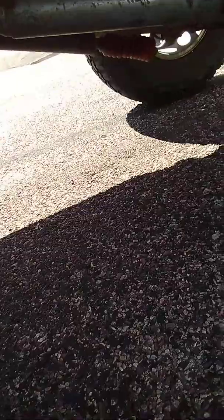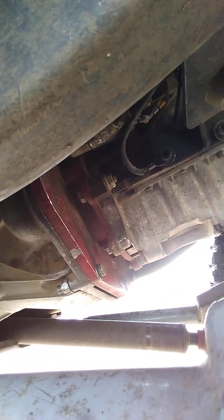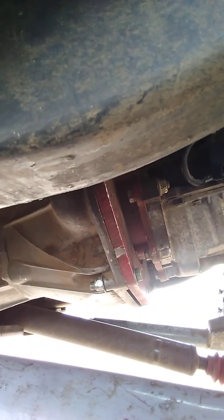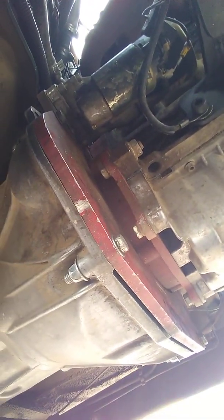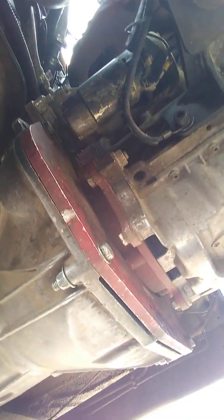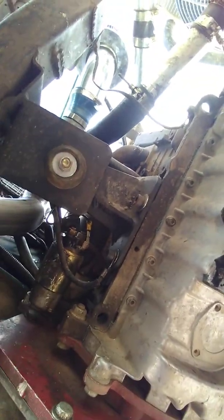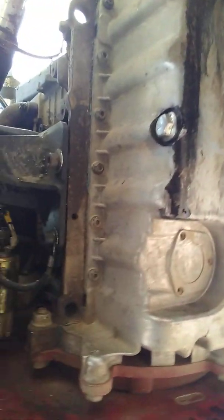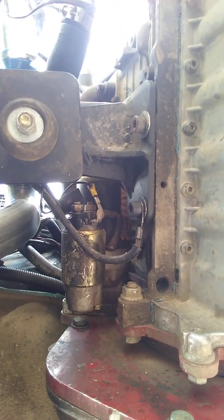The adapter kit is the most expensive part and I went with TD Conversions - they're updating some stuff now, but it is just simply a series of plates that bolt to the engine and then bolt to the transmission. It basically just hooks right in like you're putting the factory engine right back in there, and gives you a nice little starter that lines right up. If you slide under here you can also get the motor mounts - at least the engine side comes right from TD Conversions as well.